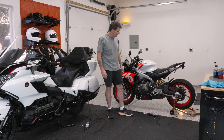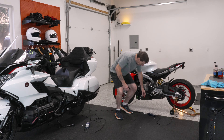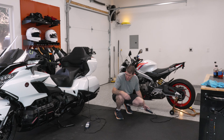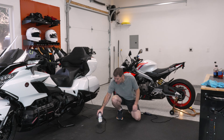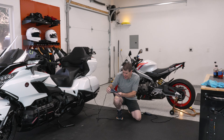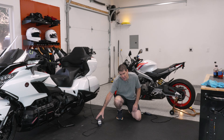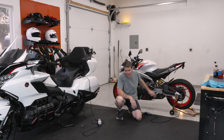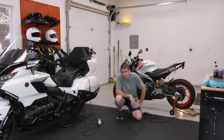You've got to make sure with your lithium batteries that you've got a lithium charger. This is an OptiMate — it's green. This is the other OptiMate — it's red, and it's the gel version. It actually works on lead acid too. If I plug this into my lithium battery, it won't charge it at all. So make sure you get the right charger for your battery type.